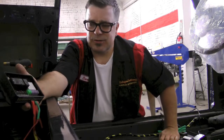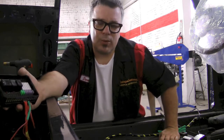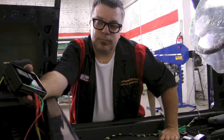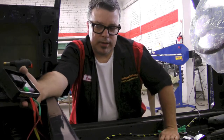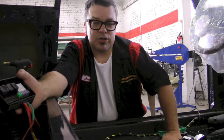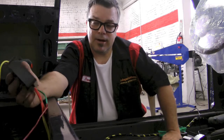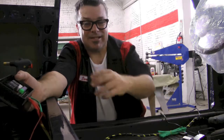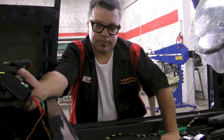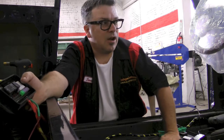If you wanted to add stereos, GPS, or a functional lighter power supply, you can now do it without wearing out your current older fuse block. We're putting this in the trunk space we made because there's no rear seat in this car — it'll be a platform with storage. There's going to be stereos back there, the car battery, and this unit. All the wiring is coming from basically behind the driver's seat, so when you add that length to the current wiring, you have to consider whether to upsize the wiring.